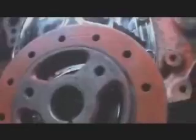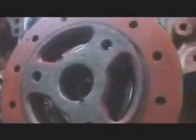and for those of you who often wonder if you've got it on there good enough, if you've painted the balancer first, you'll be able to look inside and see where the paint line ends, and you know that you have it on all the way. For those who get worried about lining up pulleys and things like that. Okay, now we've gone ahead and pulled it on with our bolt. I know they say not to do that, but it works okay with this one.